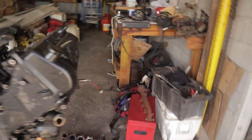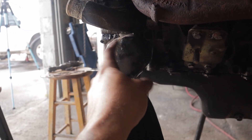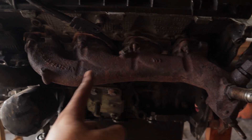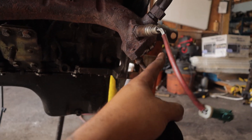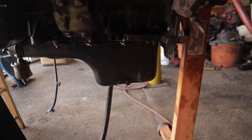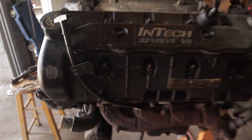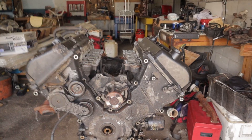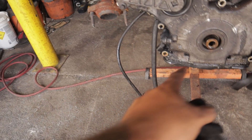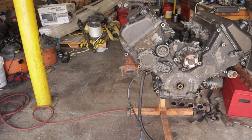What I'm having on the driver side is that the water outlet for the block and the oil filter are in the way of me actually turning this header forward. So I'll most likely have to leave this one backwards and build a small pipe that comes out underneath the motor and comes to the front, meeting whatever flange I have at the front of the motor. I'll most likely build the pipe off of this, bring the other pipe up, connect them, and that's probably how we're going to run the turbo.